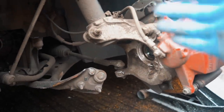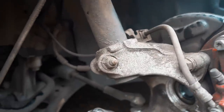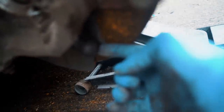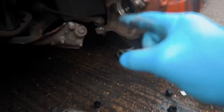I've removed the drive shaft, I've removed the wheel, and I've got a better view of all the damage. Dare I say I've struck luck on this build so far. It looks like the shock is okay, but I'll know more once we drive it. The hub is okay — it's just that the ball joint has popped out of the bearing. I need to get a new wishbone which I've already got, and it looks like the control arm for the steering is okay. I'm happy about the drive shaft — if it was breaking you'd be hearing a crunching noise when you shake it. So I'm gonna reinstall this into the gearbox — it just pushes in — and hopefully we can get the car running, but first I need to remove the old wishbone.